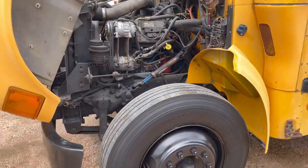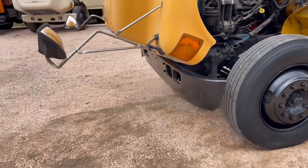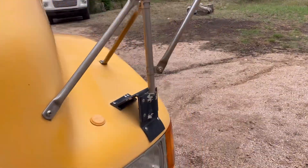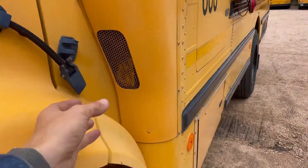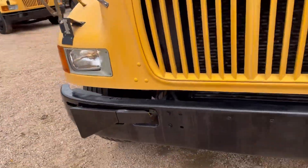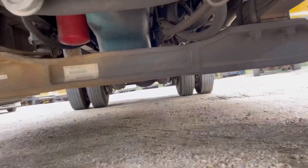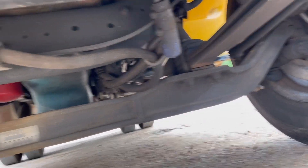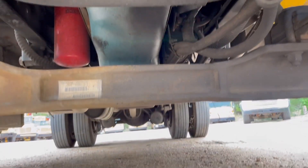On this bus, just notice how clean that engine is. With any diesel bus, you should expect some pretty heavy buildup from the years — they're old diesel engines, so lots of buildup is to be expected. So this is a super clean engine. The main thing to look for when considering leaks: it's super clean, next to no buildup, clean pan.